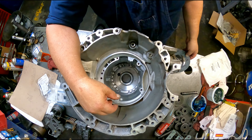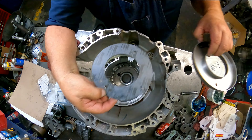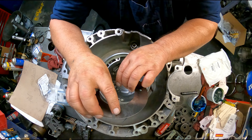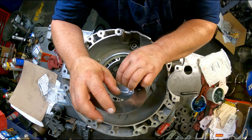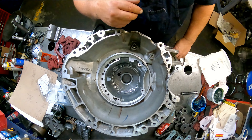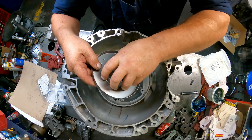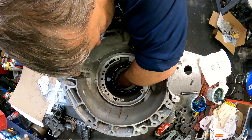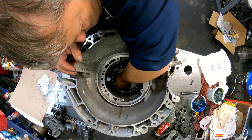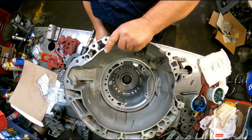Get it down into that hole where it's nice and flat. Take the gasket that used to go underneath this plate — you do not use that anymore; it comes with this plate. Make sure you line up your slot right here with the vent in the piston, otherwise you're going to create other problems. Just line your holes up and use the regular bolts that come in the kit — 25 torque — and torque it down to what you always torque them down to.